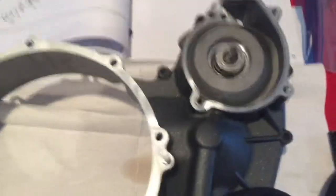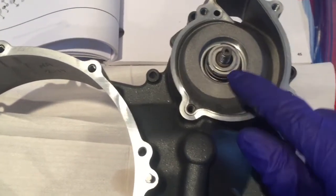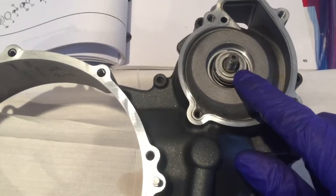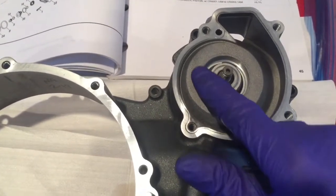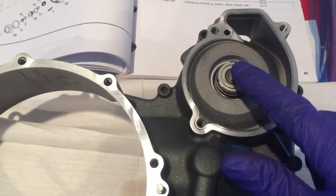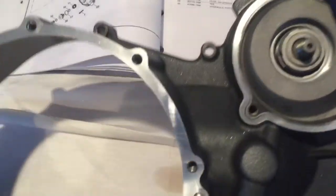This is your water pump area. What you're looking at on the outside is called the rotary seal. Beneath that is an oil seal — I'll have some pictures of this later in the video. The next step is to press out this gear. On some EBRs it might be easier than the 1125; I had to push it out as it's set in there pretty good.